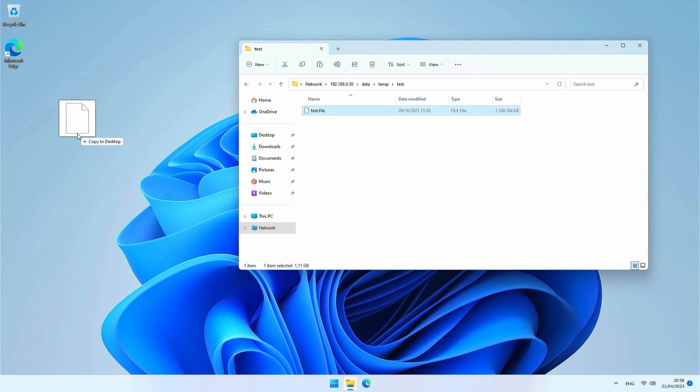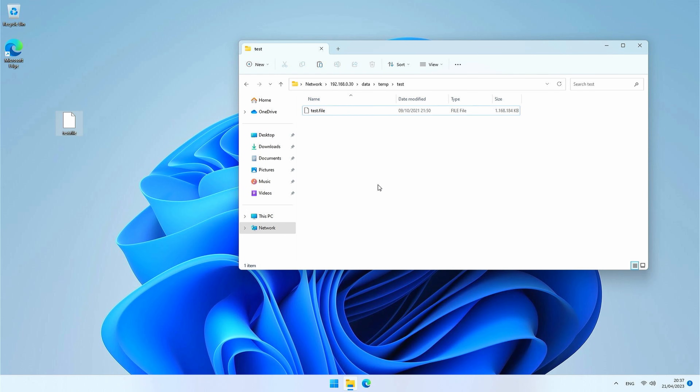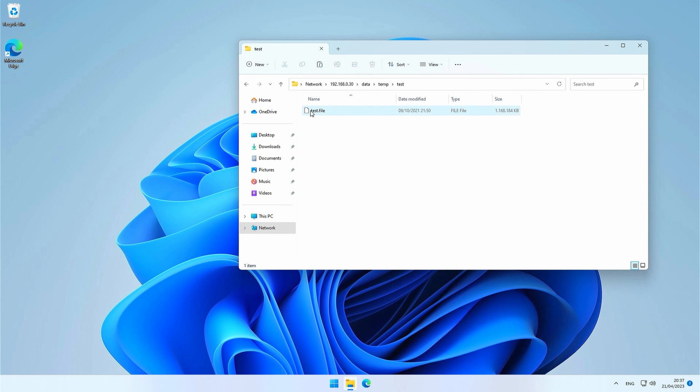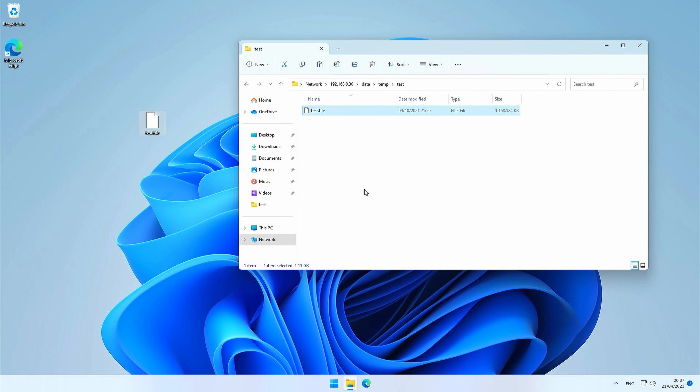As a last test, let me connect to WiFi and check how that performs. I'll copy a large test file over the network — around 20 to 22 MB/s, which is about 180 Mbit/s. That's not great, while coverage is fine and nearby devices like my phone can easily get more than double. To show this isn't an issue with the network share and also to test the wired network port, let me repeat the test with a cable connected. A solid 112-113 MB/s — the maximum of that gigabit connection. So wired works as expected, but WiFi is not the best in here.